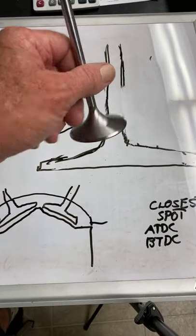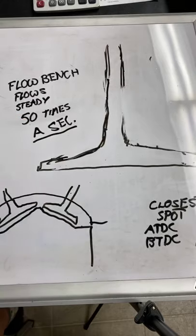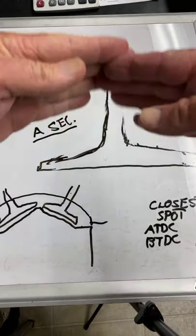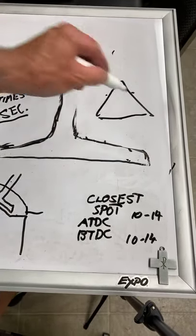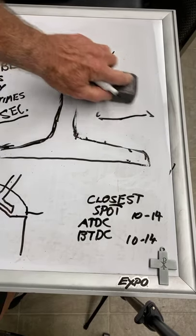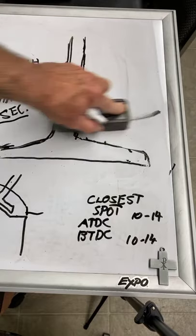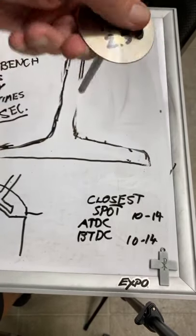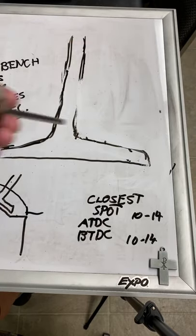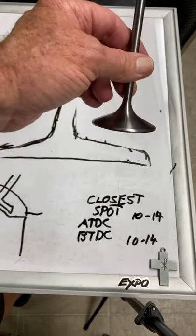Here's an answer to this question: build a lighter part. Here is a titanium valve - very similar in shape to the stainless valve. It's flat on the face instead of dished, so it will not fold up like a lawn chair. You know how strong a triangle is? It's hard to bend one of these sides. It'd be easy to fold this up if it was a nail head. We need strength in the right place without adding a bunch of weight. So here's a nice titanium valve - it's 2.3 inches, a little bit bigger than this one, and it weighs 107 grams.